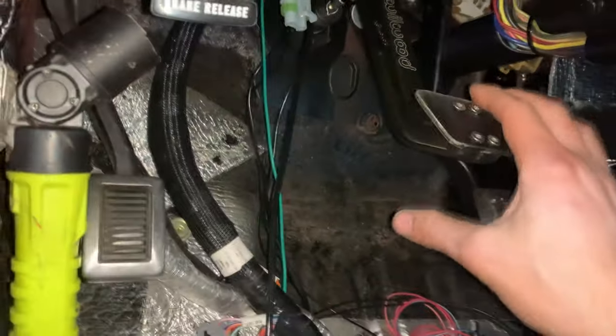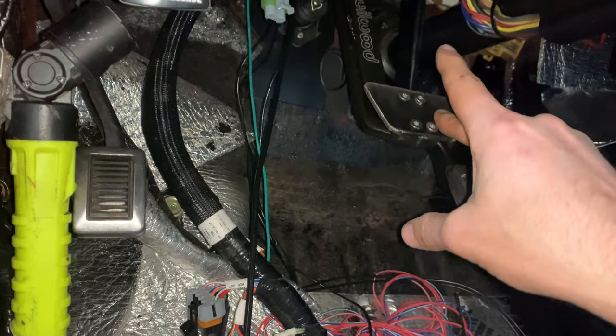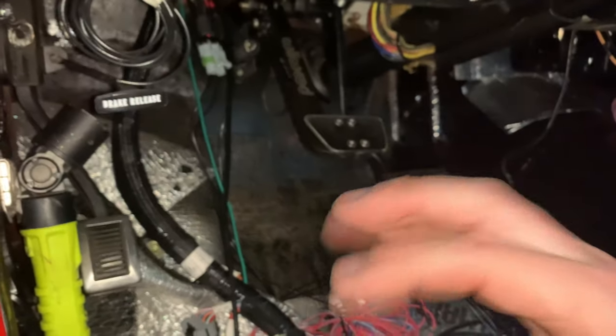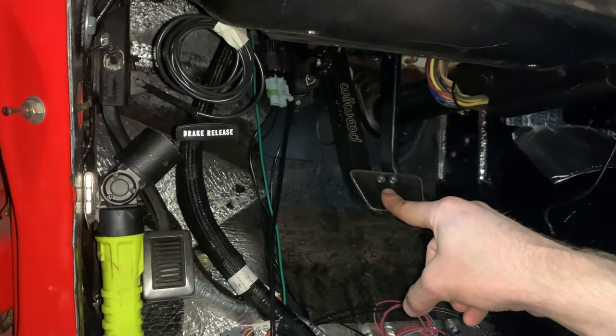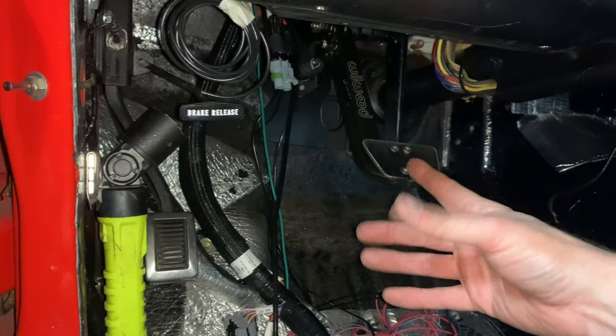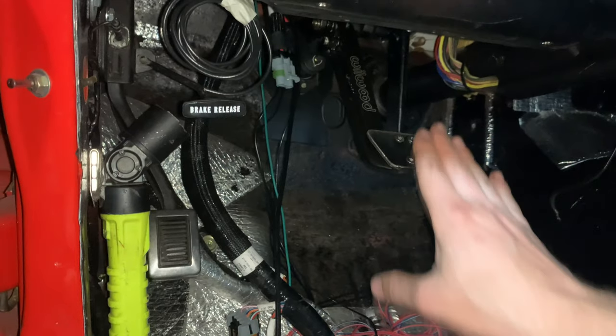The bad news is, it seems like this clutch master cylinder I have here maybe is not the correct bore size for this transmission. I really searched for the right volume. I tried Googling TR-6060 slave cylinder volume, and there just doesn't seem to be any information online, unless I missed it. I found somewhere that somebody mentioned a 5/8 bore, which is what I have here, was the right size. That's a good compromise of pedal feel. The throw is good, but not too stiff.